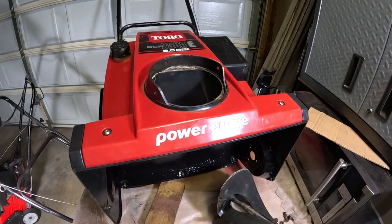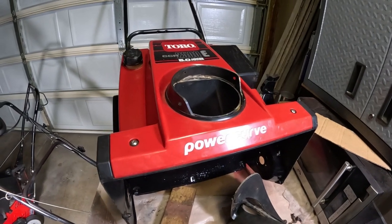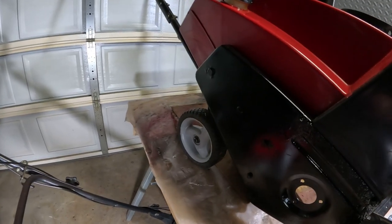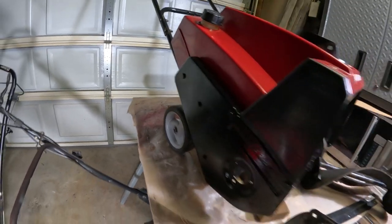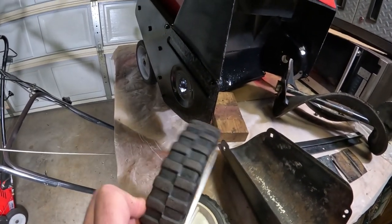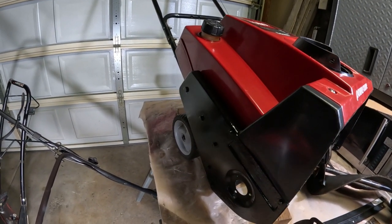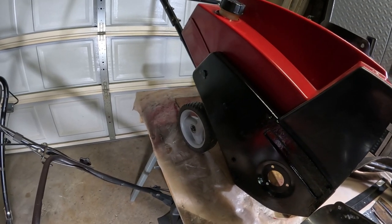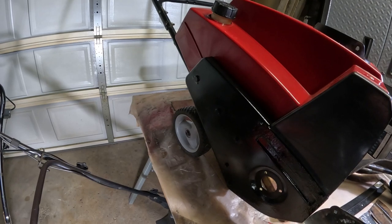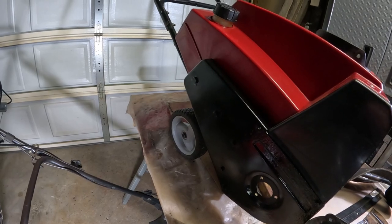I do have a heater in here, but when you start introducing chemicals, especially flammable ones, you really have to be careful. We cleaned up the sides and replaced both wheels — here are the old ones. They were kind of wobbly, moving back and forth. I keep all parts, so I had wheels from lawn mowers that were exactly the same size. These are typically from non-self-propelled mowers, since the self-propelled ones have plastic teeth inside the rim.